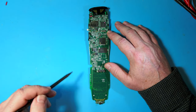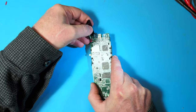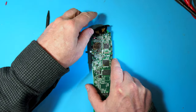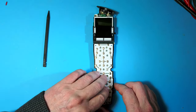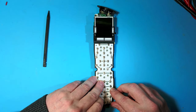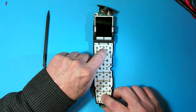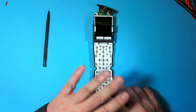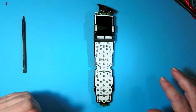The battery sits here. So what I'm going to do is take this off and move it to my board. You can see the two LEDs better now in the USB connector. Then I'm going to use my rework station heat gun, you can use a hairdryer or something as well, to loosen the cement on this. I probably could just peel it up and then see about collecting some of these 5mm snap domes. Now, P1 Repair sells a kit of snap domes, so if you just need snap domes, go to him and order them, and life will be great. So let's get to it.